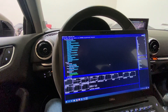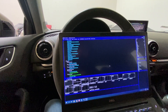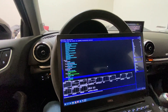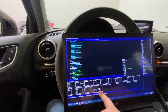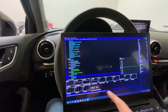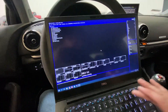The tire scaler is cool: if you have mismatched front and rear tires - like a taller tire in the rear as the stock car does - you can come in here and drive down the road, look at your center slip, and then figure out how much of a multiplier scaler you need so the center slip reads zero when driving down the road properly. Anyway, I hope that was informative.